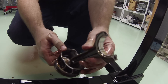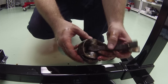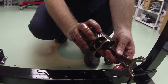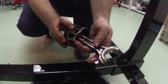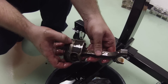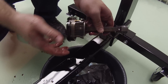That is amazing that it didn't completely come off and destroy the engine even more. Chances are this could have been broke for quite some time and it finally let go at the top. What happens is when it breaks, you start getting blow-by and stuff, and then it melts. And when it melts is finally when you notice it's misfiring and burning a little bit of oil.